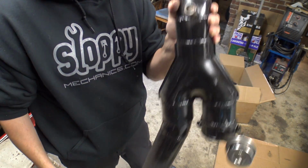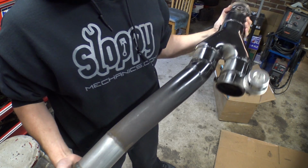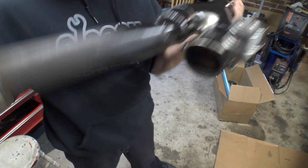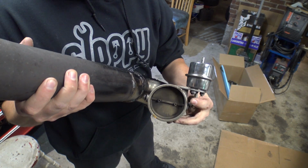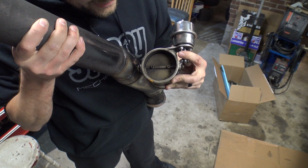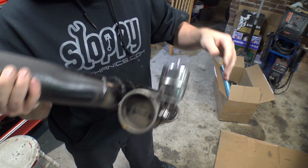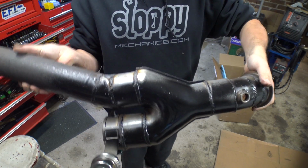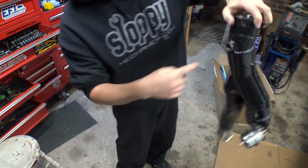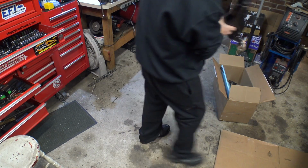We come off the turbo, and that's the 3-inch exhaust that goes down under the car, nicely V-banded on. And then what happens here is when boost happens, this guy opens up automatically, lets out all the pixies, all the horsepower pixies. Works great. Nice and quiet. Good split on there. I just bought that off Summit. A 3x3x3, because I try to build a few merges, and quite honestly, I do an awful job.